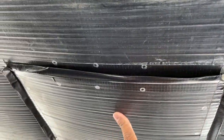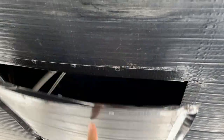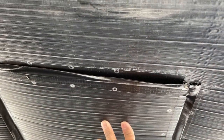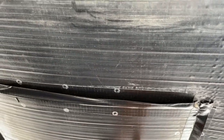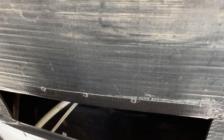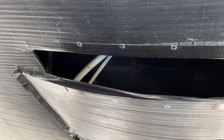Now that we have all our holes marked out, we're going to drill them out — but I'm actually going to use a soldering iron. Get the tip really hot and push it through the plastic. That's going to make a better hole than a drill bit, because a drill bit would just shred this plastic, and if your underbelly is brittle from age it would destroy it. The soldering iron will melt through cleanly and also seal off each of those holes. So let's get started.